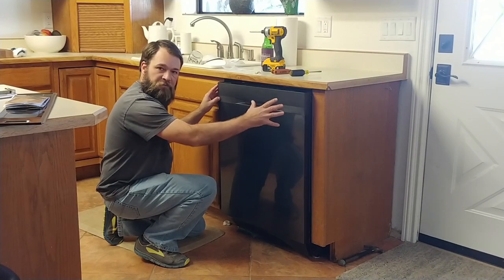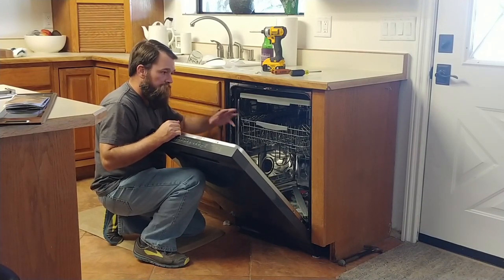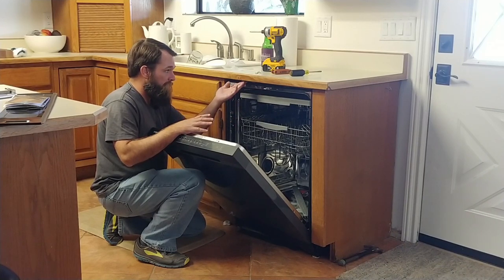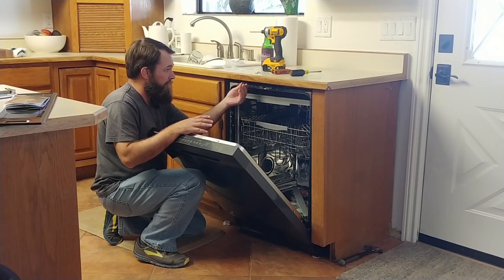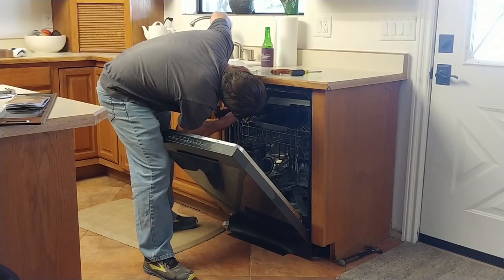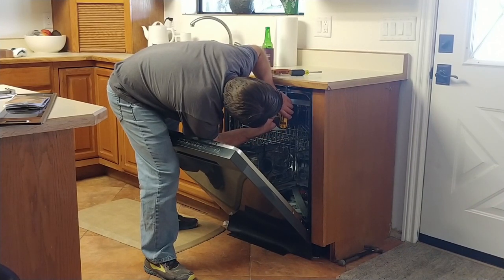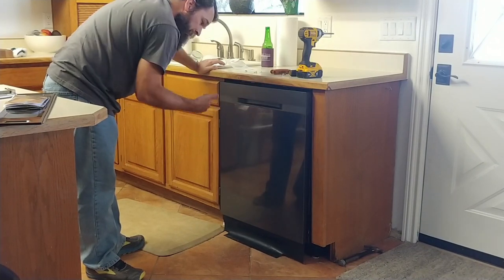Now I've got this thing leveled in the space just like I want it. My cabinets are old and pretty horrible so the way this is set up is not ideal — I'd like it to fit a little bit better — but this is what I have to deal with. Since I've got everything in place I'm ready to go ahead and fasten these things, which will secure the dishwasher from tipping out and hold it in place. Got it in place so I'm going to screw these little brackets to the bottom here. Check your screw length so you don't want to come through the countertop. Our dishwasher is secured.